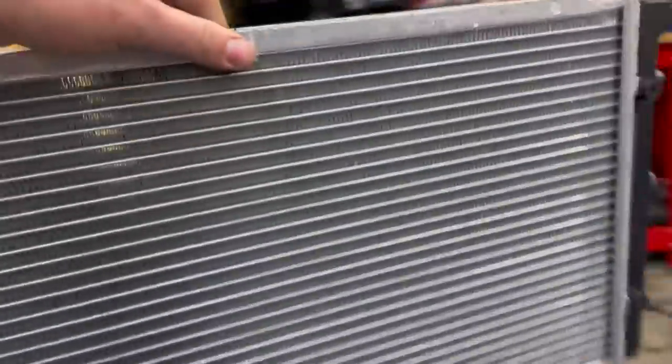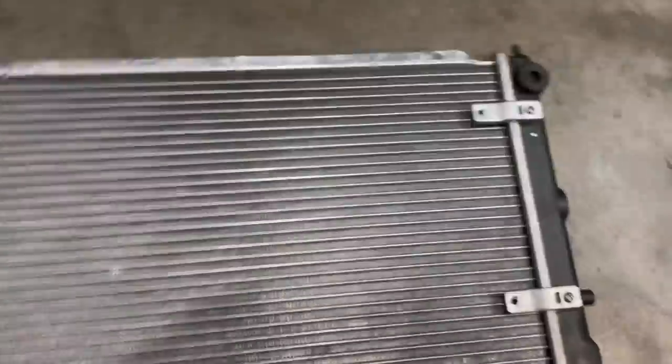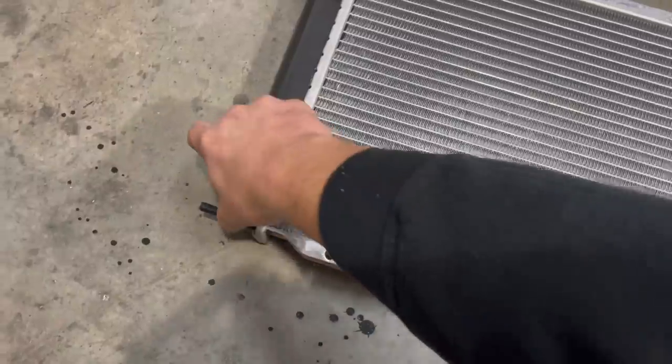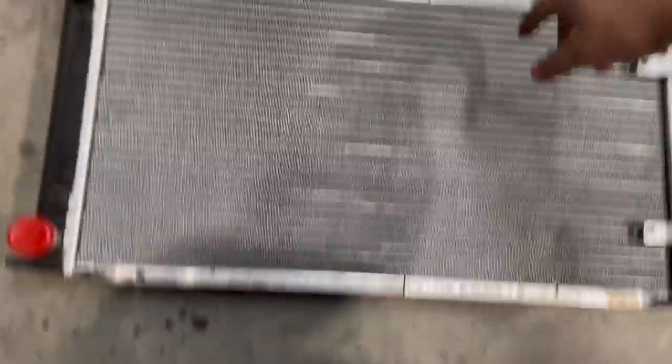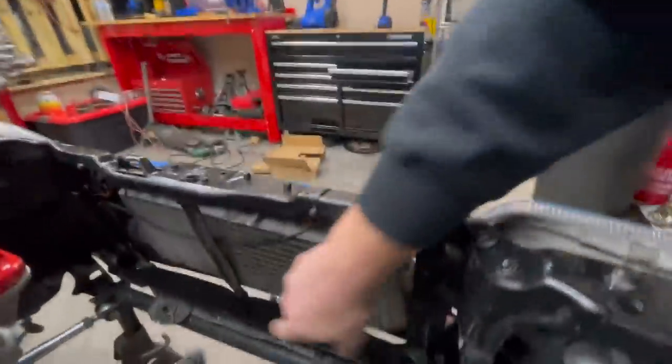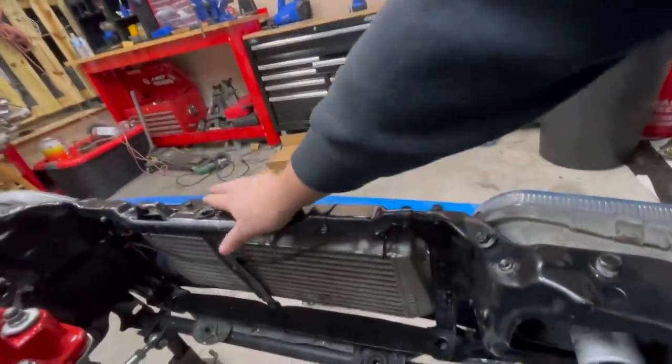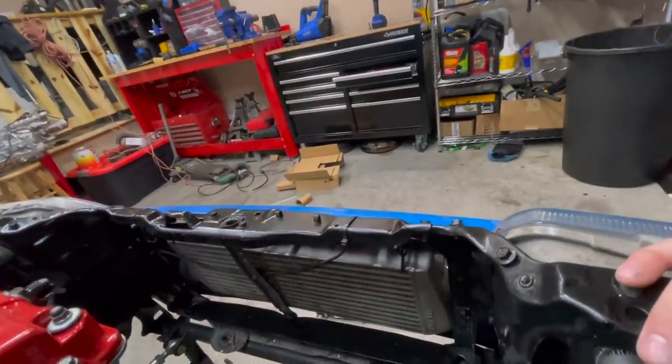I went with this radiator because from a size standpoint it looked like it'd be on point. The other thing is it's flippable — you have an M14 plug or you can do whatever, and the inlets and outlets are on the same side, so you can rotate or flip it however you want. My plan is to shove it up into the core support section where this T-bar is, take the top piece off, see how it fits. First thing I need to do is get this off, wedge it in there, and see how it goes.